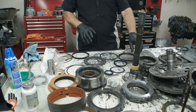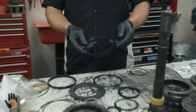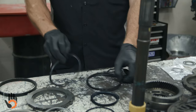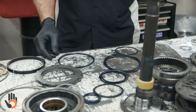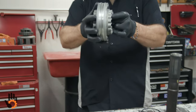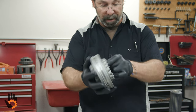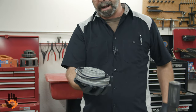I've separated them out. You can do the same thing here. You'll notice you've got a couple of the lip seals here that are the same size. You've got three total that are near the same size. One's a little bit smaller, okay? Both of your pistons that come out of the clutch drums, these two, forward and direct, are the same diameter. So very simple there. We've got two that match, so therefore we know those go on the outside of those